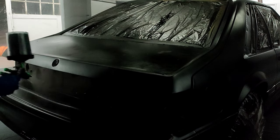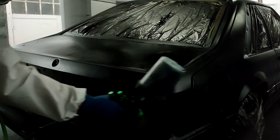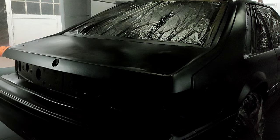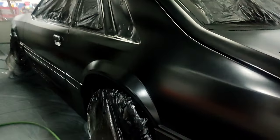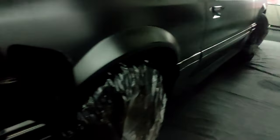A quick note on the application of the base coat: you can see I'm just barely dusting the paint on. The reason for that is I'm actually using the Speedy Coat Extra Slow Reducer. This reducer allows you to really slow up the base coat process, take your time, be patient, dust the paint on carefully, and still give you that really nice glossy sheen in your base coat right before you clear coat. This is how you want your base coat to look.